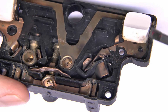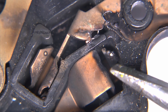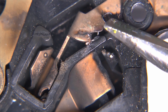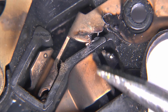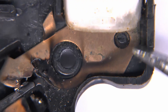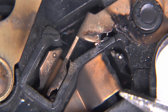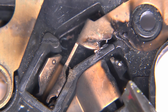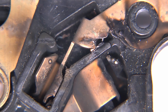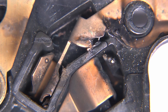Some of that has apparently escaped up here via the switch to the outside. Further in, we can definitely see the significant blackening on this terminal and the obvious melting on the edge of it, with a rather wavy edge. So that's definitely the point at which the fault occurred, and basically has melted away some of that terminal. That has then spread up here over the copper conductive path and blackened the edge of the switch. So it's either that the plug had got stuck in here, or there was some mechanical failure or it got out of position, or maybe it was overheating slightly and partially welded to the pin, and then pulling it caused it to lift upwards, move across, and short onto the other piece.